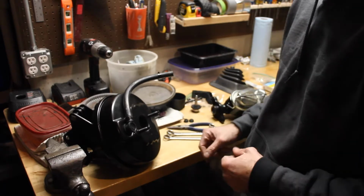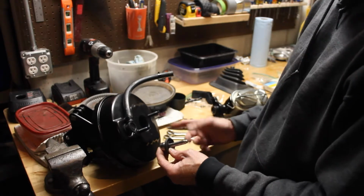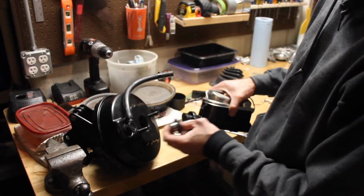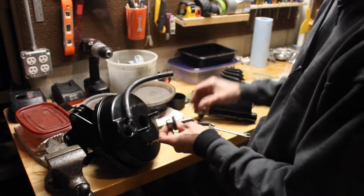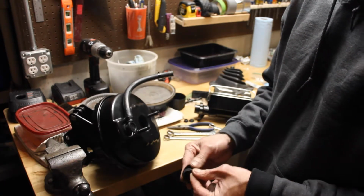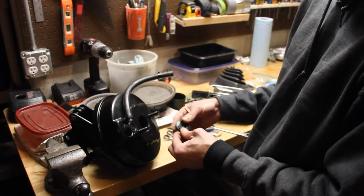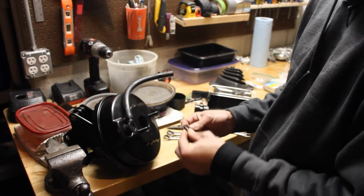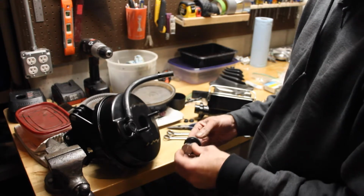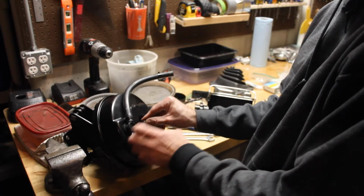So now we're going to put on the master cylinder. It's really simple. There is a piston pin, where the pressure from the power booster goes into the master cylinder to provide that actual power brakes. And this is just a simple disc. I actually took this thing apart too. There's kind of like a copperized washer on the inside of it. I powder coated that. Yes, I know this is extreme, but I'm trying to make this thing a forever Jeep. And then I used some steel wool to clean this up. And then that just sits right in there.